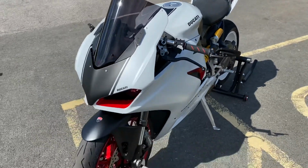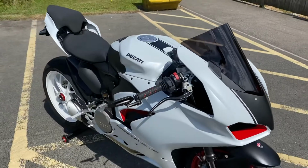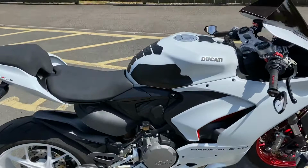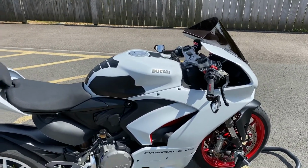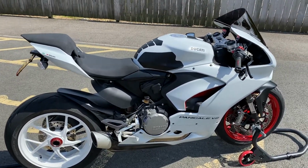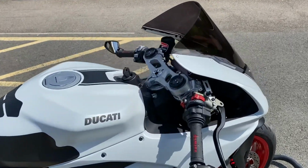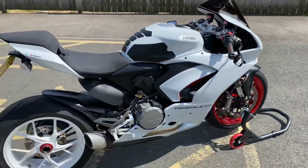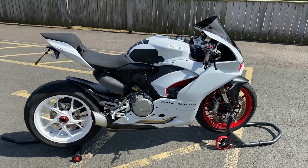Like I say, I watched a load of videos on YouTube. People were using hairspray, they were using all sorts of stuff, and they seemed to have a right chew on. The best way to do it by far is by air: putting the grip over the bar, sliding the airline up the back, squirting the air to pump the grip up, and they slide on unbelievably quick. It's literally a 20-second job if you've got an airline. However, I don't have that option, and I came across that little hack purely by chance.